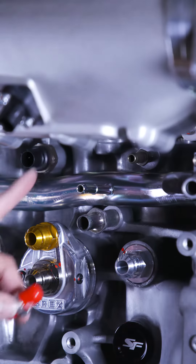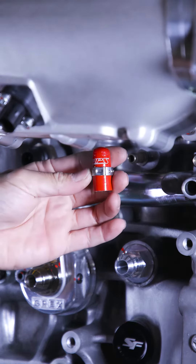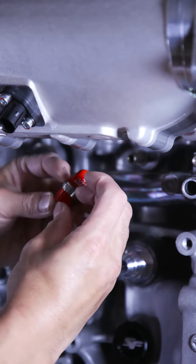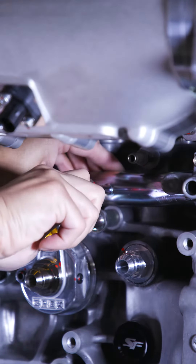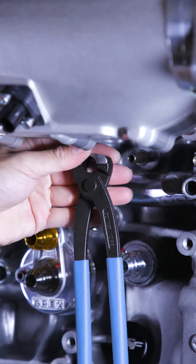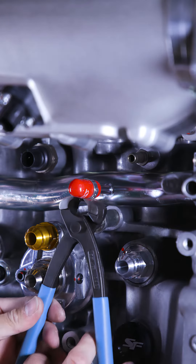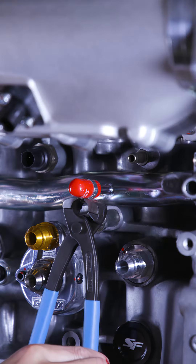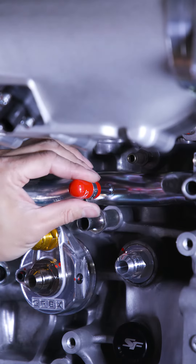So I'm going to show you how this goes on. If you guys are curious what this is for, this is actually for the idle air control valve loop, and I'm going to delete it because I'm not going to be using my idle air control valve. So here it is — I got the clamp right over the cap and we're going to slide this guy on, super easy. Then you take your tool, this guy right here — I call this guy the crusher. Slide this guy over and then we're just going to crush this to spec. And there you go. It doesn't need to be gorilla tight — that's pretty much permanent.